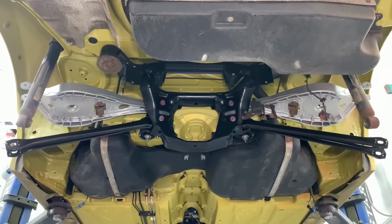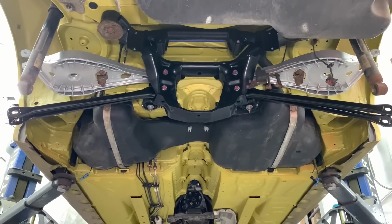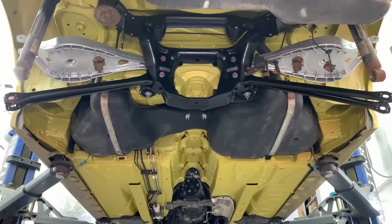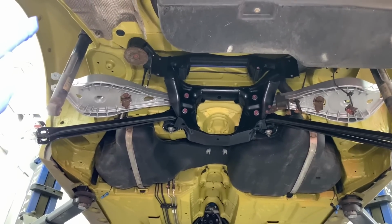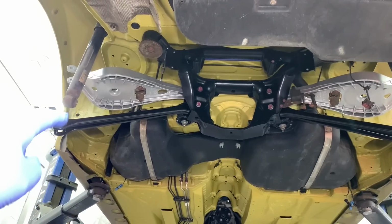Well, once the sprayable seam sealer and the top coat colouring was dried, it's come out extremely well, by the way. I love the colour underneath this, so good. We went on to do cavity waxing, which we didn't actually get on video this time, I'm afraid, but we did do extensive cavity waxing through the wheel arch holes. That's why all the grommets are still out, the rear trailing arm pocket area, in through the whole section